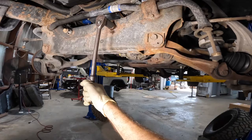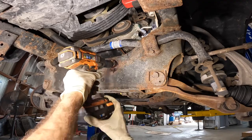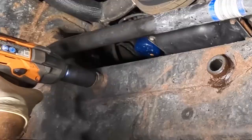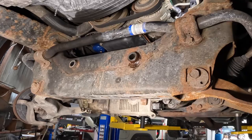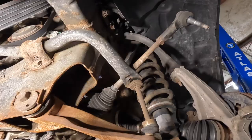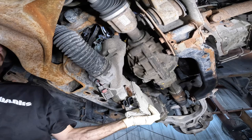Aha. Yeah. All right. Woohoo! Try again. Very good. Number two. Okay, the unit's free. It's just being held in with the tie rod sitting on top of the steering gear. Sway bar. The tie rods are on top of the sway bar. All right, so what we're gonna do, I'll pick this up and over, and we're gonna get it off of this sway bar.